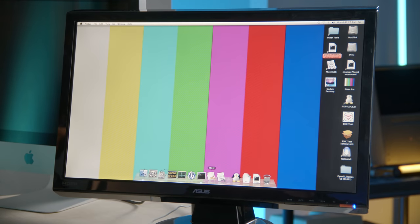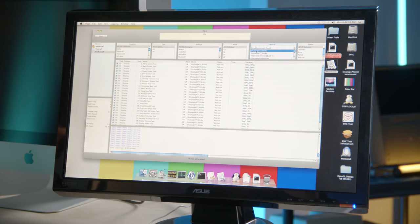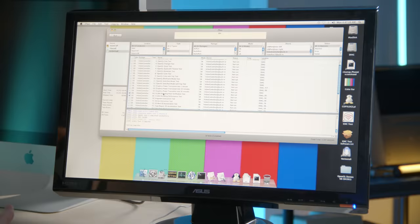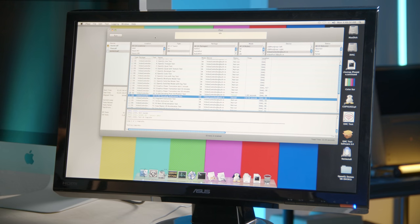We have two diagnostic tools: iTest and Phoenix CE. Let's start with iTest — it kind of reminds me of iTunes in column view. We'll choose the display device. Apparently when you run this, something crashes, so let's see. We'll run the two video controller tests which have something to do with H.264 encoding. Some stock footage popped up really quick, and now we have BBC footage. I'm guessing it's playing as fast as it can without dropping a frame. Test 66 complete. We also have a 'play rub and buzz sound test' in the audio section.